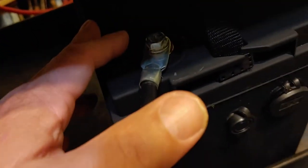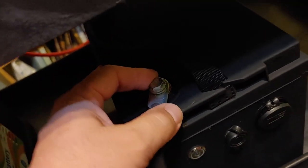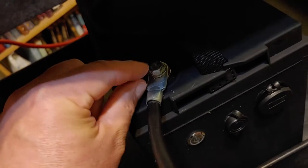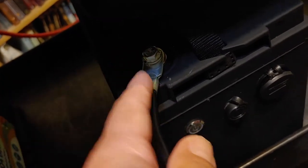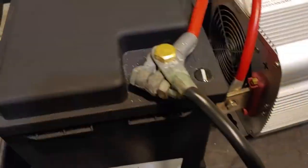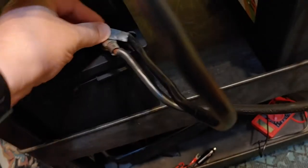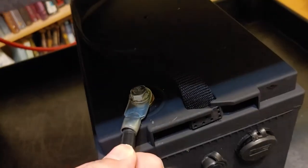This one that came with what I'll call the incorrect type of connection doesn't have an M8 — it has an M6. It's short, so it can only hold one cable, where the longer M8 ones will hold two quite easily. My solution is to use the M8 connection up here, come down to the second one with the longer bolt and use two. Then the third battery that only has the short M6 — we only need to connect one, and that will work. Temporarily, problem solved.